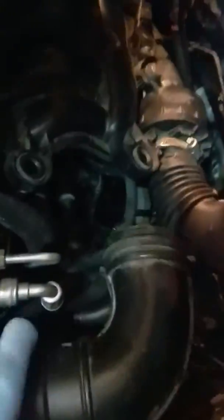When you're disconnecting this, it's kind of hard to see up underneath here, but you just have to do a little twisting motion. Instead of pulling it straight off, there are little slots inside. You can see right there. You do a little twist of a quarter turn, and then it'll pop off this end, and then this disconnects from the front. It's an air dam that goes through right here. There's an opening here that takes air inflow, and then you just snake this thing out and disconnect this little tube that's on there.